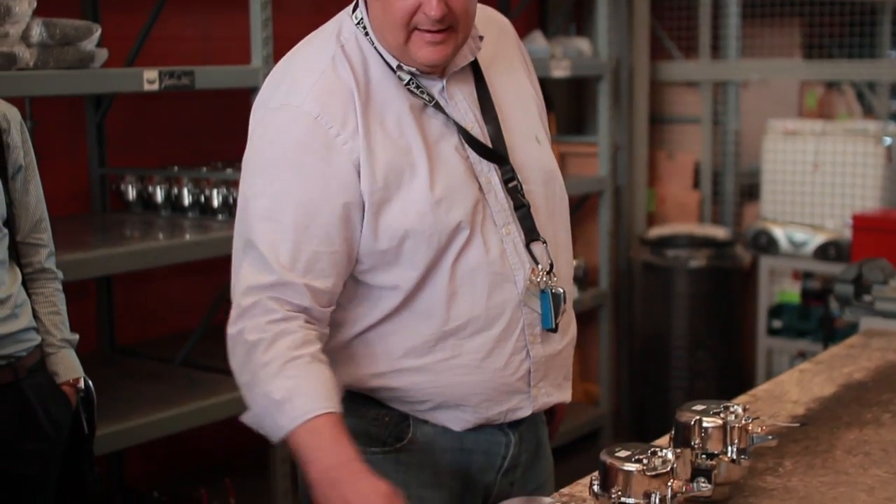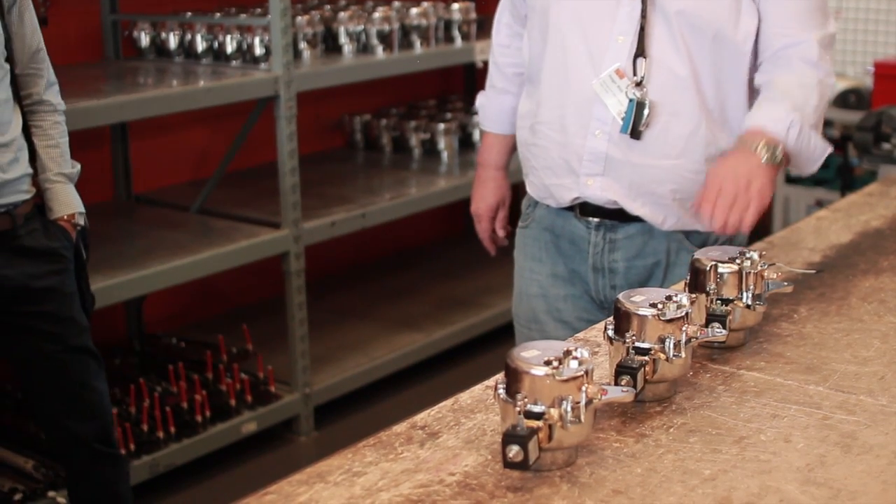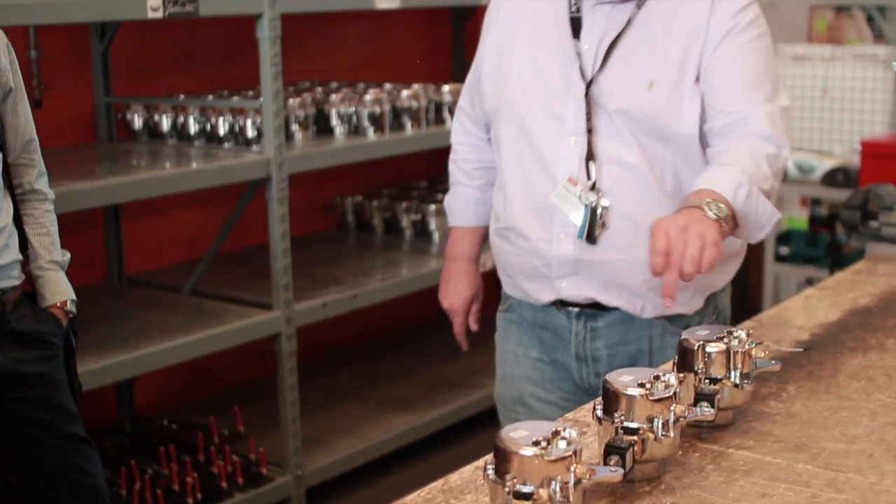So now if I have three groups plus a boiler for steam and tea water, we leave this alone. You have to understand the difference: I have one electronic board with one temperature probe, and I go with cold water into each and every group head. I can set the temperature on each and every group head differently, because each and every group head is a different espresso machine — totally separate from each other. That's why we said we have to give it a name: it's a multi-boiler machine, because you have multiple boilers and each one is independent from the others.